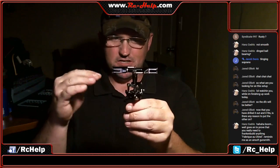So, yeah, right about there is about zero pitch. And it's just slightly up on the swash drivers. That's not a deal killer. But I do think I want to take this out to the garage and grind that lip off of there. Because all this swash driver is bolted to, these mixing arms are mounted to a block that looks just like the block that's clamped on there. So this is an old design with the floating swash driver block. Very old design, very easy to get it turned off. Just a little bit off to where if you hit forward cyclic, it would actually kind of go off in one direction or another because everything's not timed.